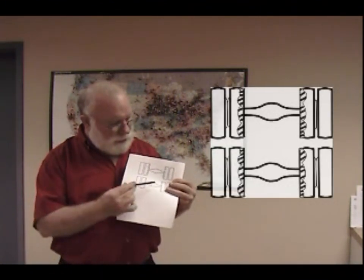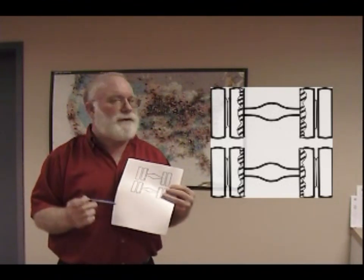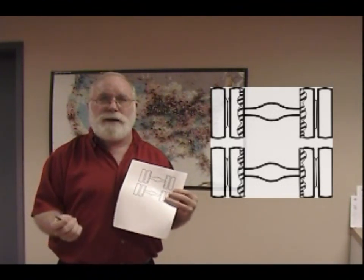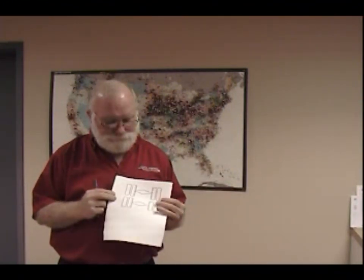If you have loose wheel bearings on a dual wheel, it'll show up as cupping on the inside edge of the inside tire. It's a very common problem to see in the field all the time on trailers and drive axles. These are our tire wear issues. Feathered wear caused by toe and drive axle alignment. Cupping wear, which can come from the misalignment of drives and toe, and the loose components. We get past these, this tends to solve about 95-98% of the issues most of the fleets have got.